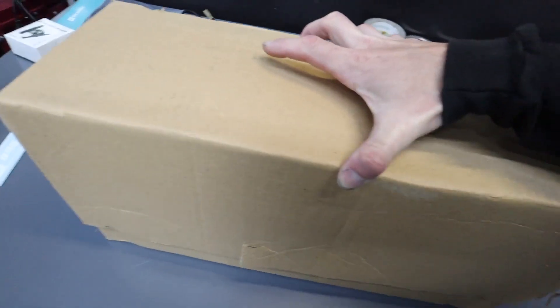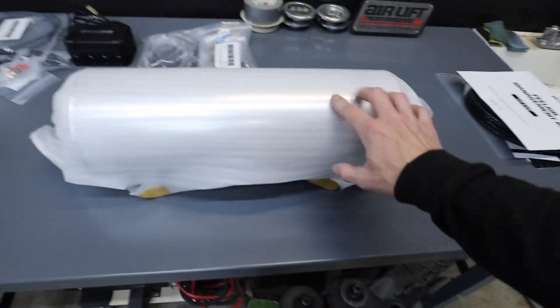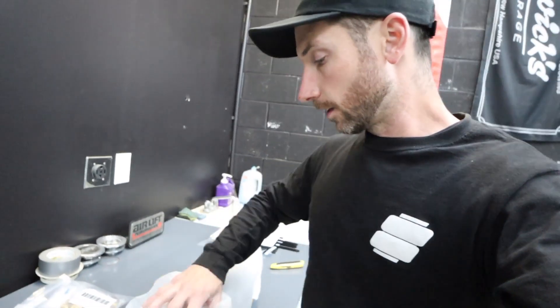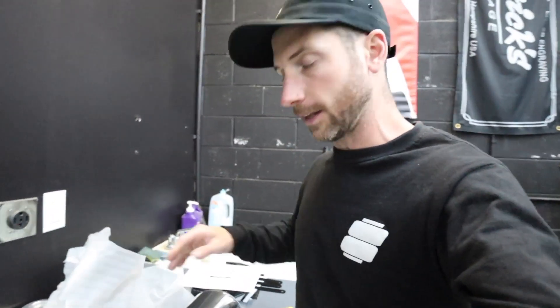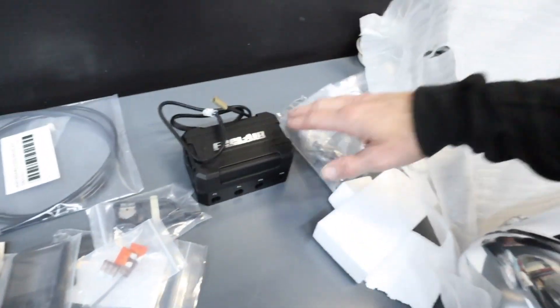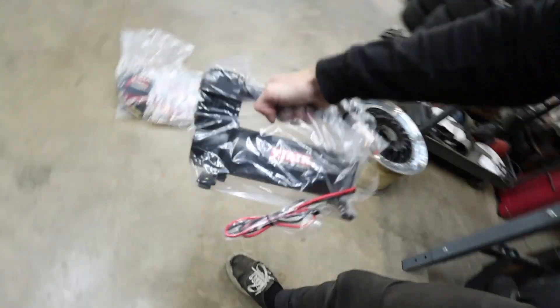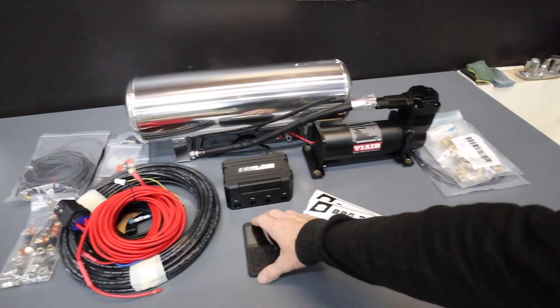For the tank — it's a little two-and-a-half gallon, but the car is not that big and not that heavy. I want to put all of this in the spare tire well. A couple months ago I did a series on bagging an S124 estate wagon out at my friend Sutton's shop in California, and that car was really challenging for hiding the management in the side spare tire well. But it got me thinking about this car — I really want to put the management in the spare tire well here too. There is a pretty deep well I can fit some stuff in, and with the 444 Via Air compressor we're going to be in good shape as far as air volume and capacity for how heavy the car is.